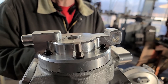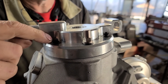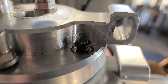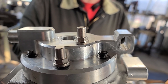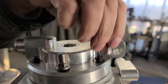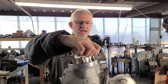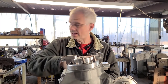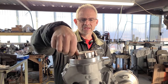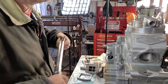You'll notice something a little different here - I hate the crush washers underneath because they leak so many times. On all my heads I cut and install an o-ring that drops on here, and then I use these stainless steel nuts that you can get from Bob Albright or David Noss. This is what CP Industries uses on all their heads. I've been doing this for a long time and we just don't end up with leaks on the head nuts. The o-rings are reusable over and over.